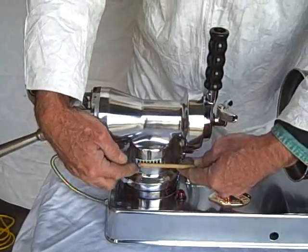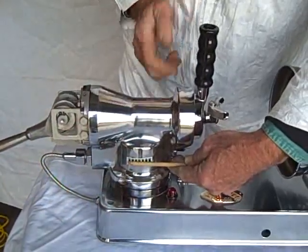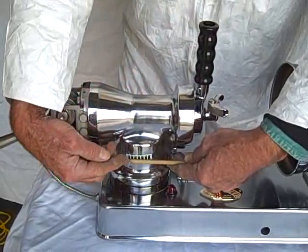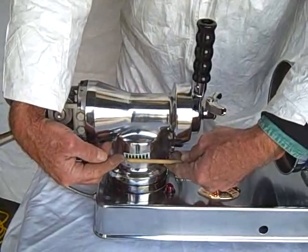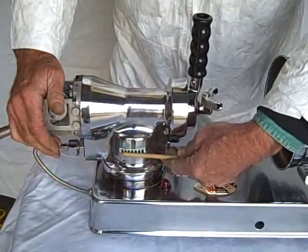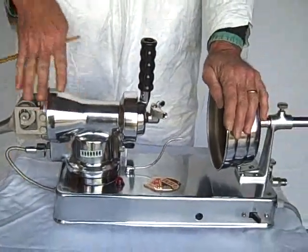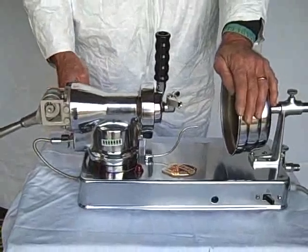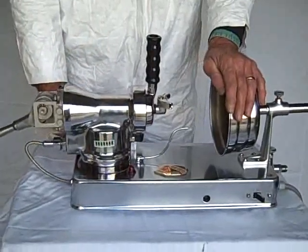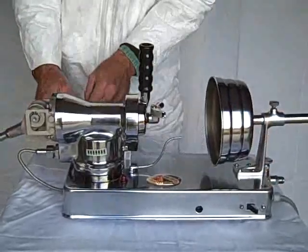This means a big problem was solved in that you want hot water into the group. As you pull the lever down, the line refills the group with cooler water than you want to use. The source of the water is from the very top of the boiler, and the boiler automatically refills back up to the top. This gives some issues with steaming, because your first few seconds of steam valve usage is straight water, so that's going to take a little technique to get figured out.